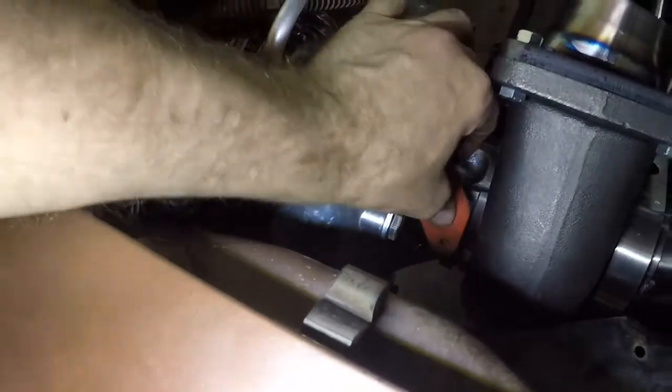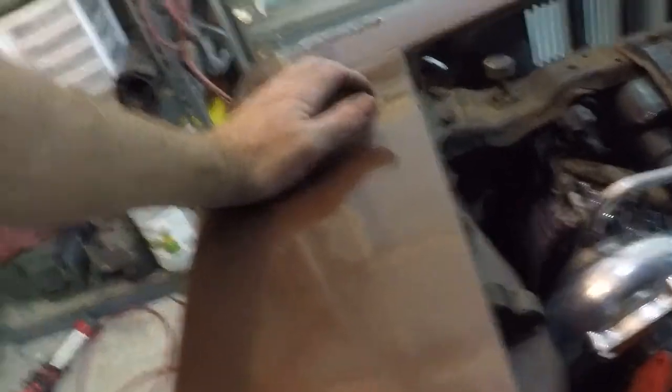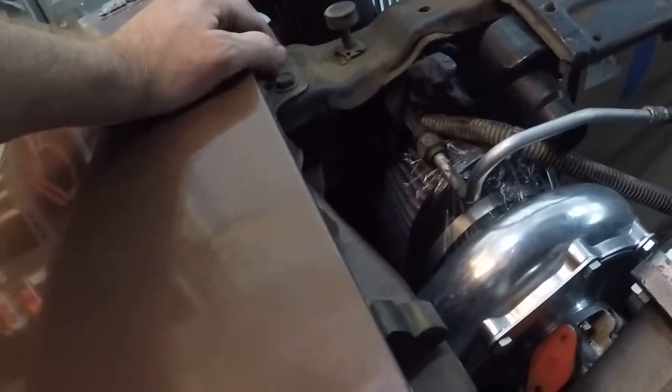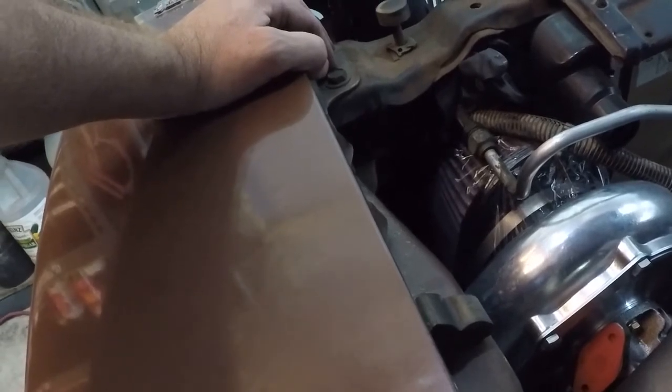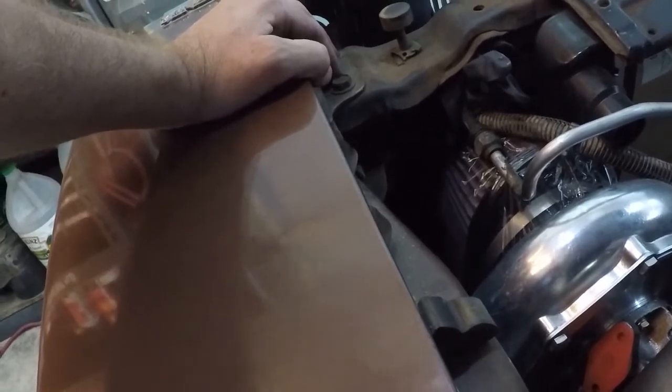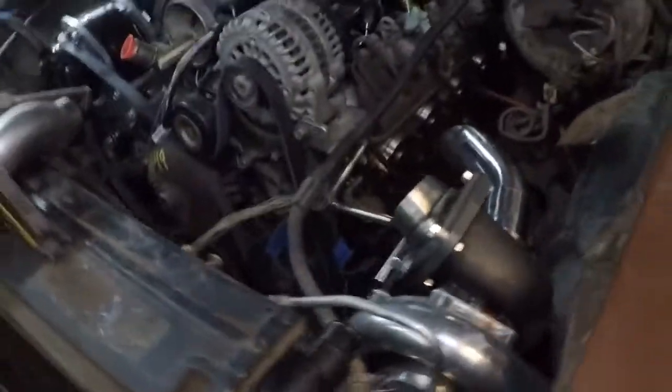Just take your time — it's not too terribly difficult to figure out really. What I forgot to talk about is turbo placement. One thing you've got to make sure when you're placing the turbo is that you're thinking about everything that has to go on, with, and around it. Don't forget that you have to let it breathe — it's best to have it filtered. I got an air filter that fits in a tight spot, and I plan on using it because I like my piston rings. Don't forget you have to get oil in it and oil out of it, and the heat that's created — those are just some of the few things to think about when placing your turbo.